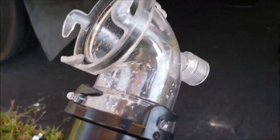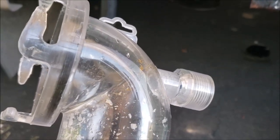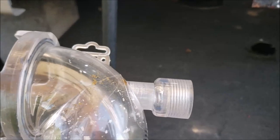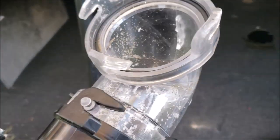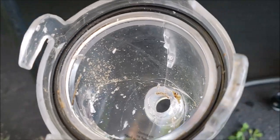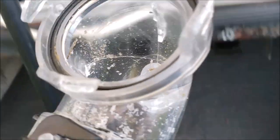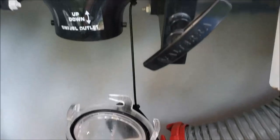Since I'm dealing with the dirty end of things today, I'm going to do some experimentation. Filling up the black tank through the sani flush jets takes forever, and we've established those jets are really just spraying the back side of the sensor. So I've got this little device — it originally had a little nozzle that I drilled out with a 5/8 paddle bit. These are designed for black tanks where you can shoot a powerful spray straight down the throat of it, but with this application that wouldn't work because it'd just go straight up into the Y.